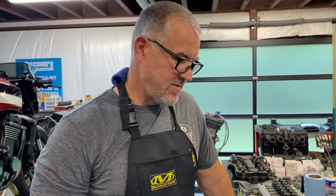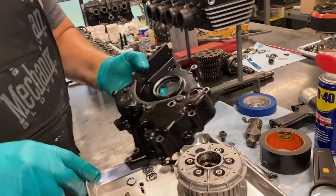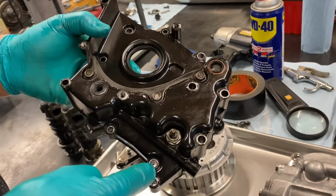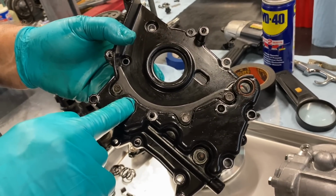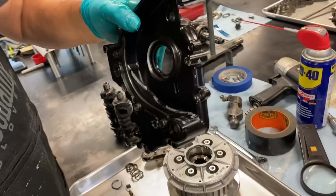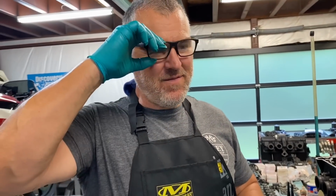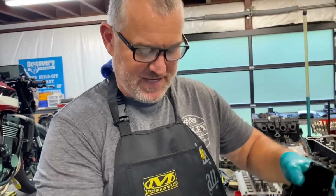As we're tearing it apart, go to pull the transmission cover off, and this thing always had a little oil leak, and I thought it was probably just around the shaft, the shift shaft seal, or the throw out rod for the clutch, or the slave cylinders sometimes will weep past the seal. But I'm always finding a drop of oil, very rarely, but every now and then there'll be a drop of oil somewhere under the bike.